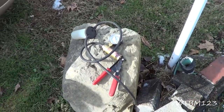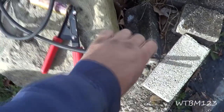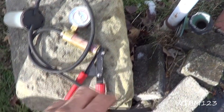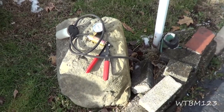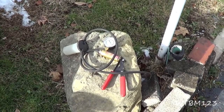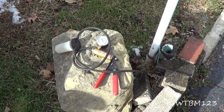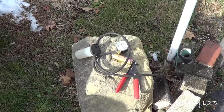One other thing — I use a brake bleeder like this where you stick it over the bleeder on the wheel cylinder cap and pump it up to create a vacuum. It sucks fluid through; it's kind of like gravity bleeding, only it speeds the process up. I bleed most of my brakes by myself and can usually get it done with that.